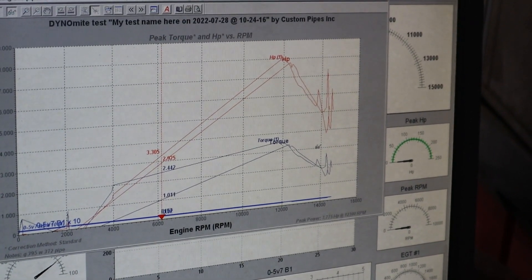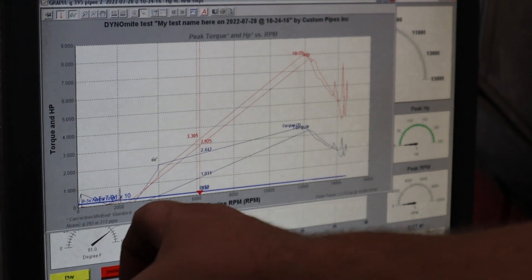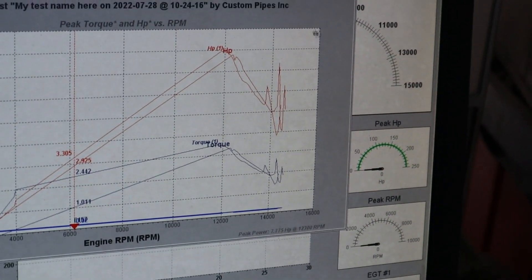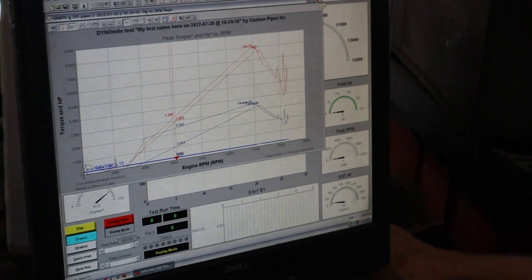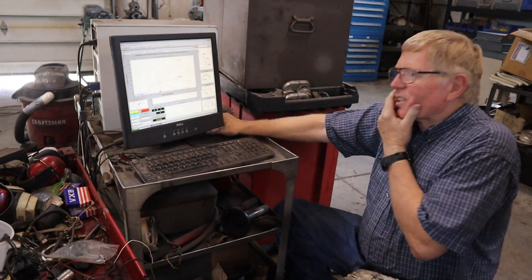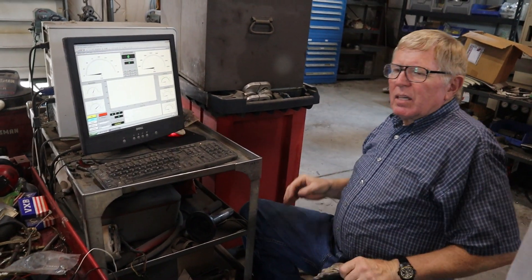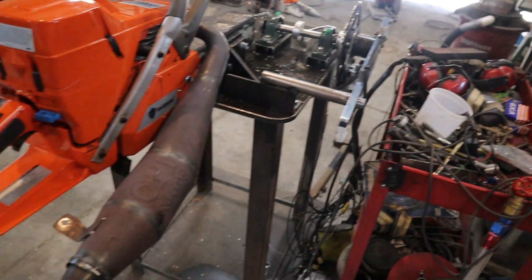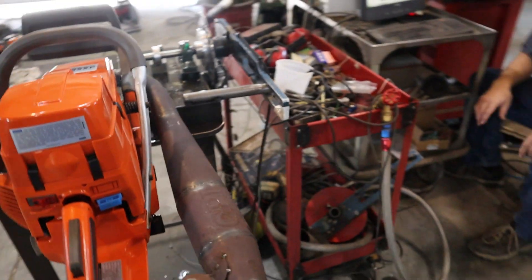The first pipe's power ramp goes almost straight up and then it kind of tapers. The second one has a cleaner ramp though. Interesting. If you're loading this in wood, the second one technically could be better — because it holds longer. And it's a higher torque range too. The real trick is what it's going to do in the wood though. That's the real test — on the porting, the cylinder. This is Chinese.